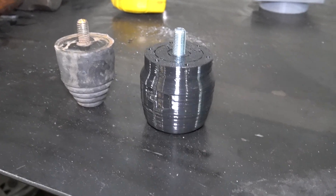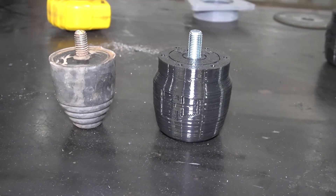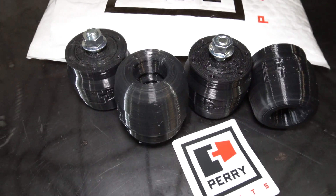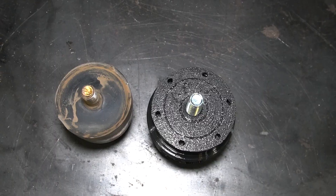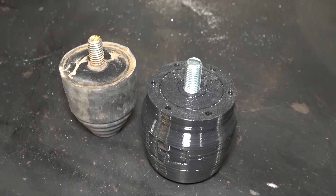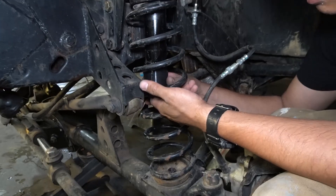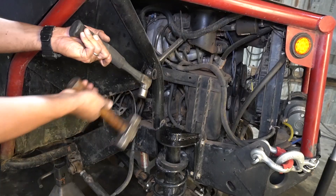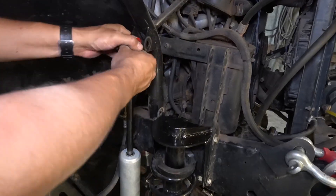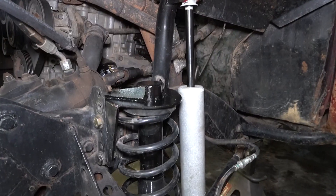On the right we've got the Perry Parts bump stop, on the left is the old hard polyurethane. The Perry Parts is about the same size, but it's hollow on the inside, and these vent holes on the top actually vent air from the inside foam printed structure for a softer dampening feel. Now that we have the right thread pitch, we can just screw the new bump stops in. The upper mounts for the shocks required a little bit of clearancing for the larger eyes, but after that everything bolts right in and we should be ready to go.